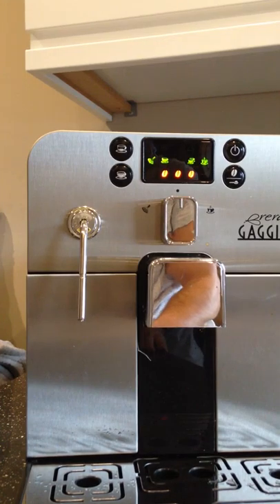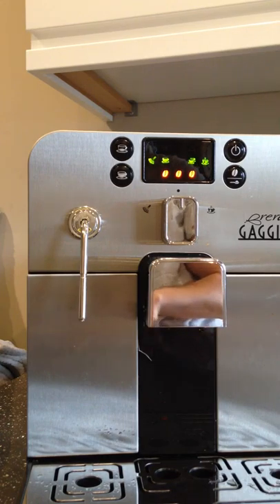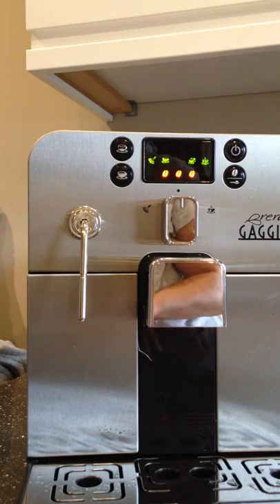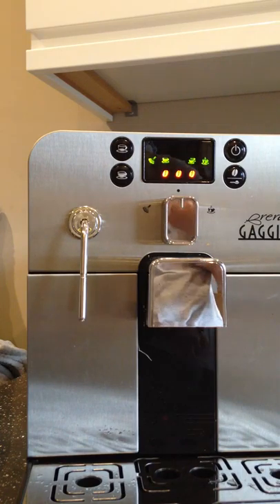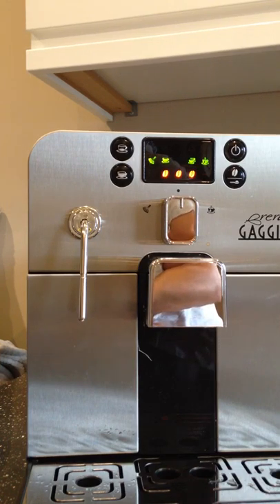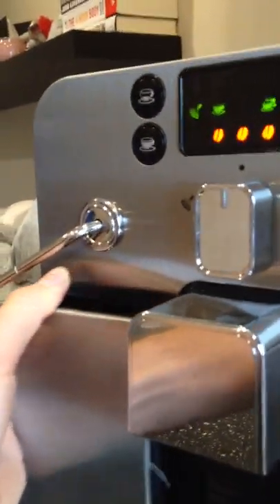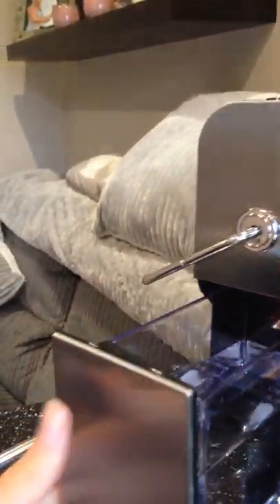I'm only using filtered water or bottled water in this machine. You can add a filter to this machine, which is important — not so much for taste, because you'd have to be a real connoisseur to notice, but more for the maintenance of the machine itself. The same way as with a kettle or washing machine, anything that uses water to function can be affected by water hardness and particles, depending on where you are in the world. You want the best quality water you can get, and you can add a water filter into the tray here — it comes out the front so you don't have to move the machine.